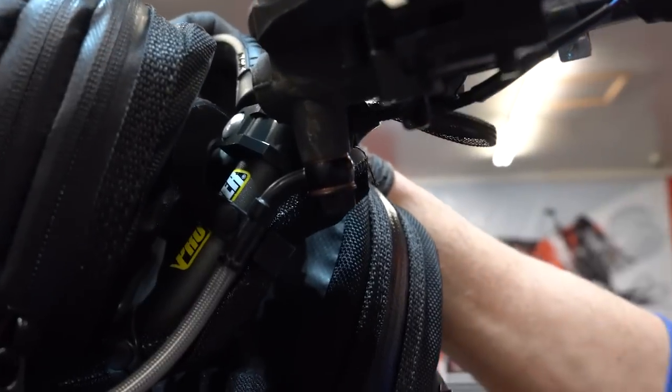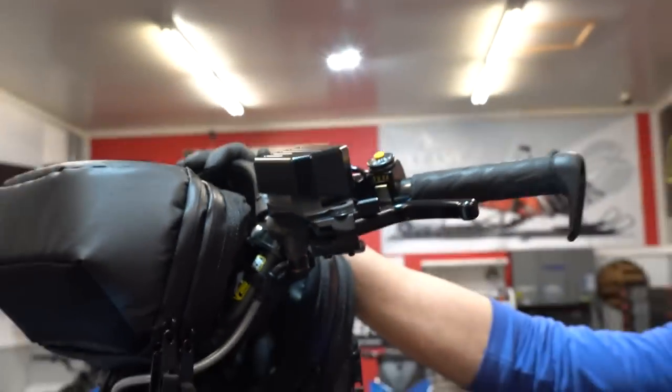Overall visual inspection of your bars, throttle, brake, park switch, kill switch — making sure all your wires are routed properly. Handlebars being tight — I've seen so many guys out there kicking their handlebars or moving them because they either didn't have the wrenches to make that adjustment right then, or they just didn't get it tight enough, or maybe it didn't even come tight enough from the dealer. Having those tools is key — we'll get into the tool list in a different video in terms of what's necessary to adjust your handlebars.